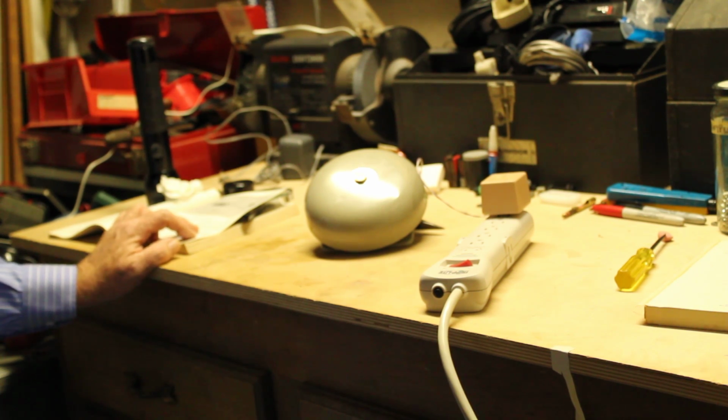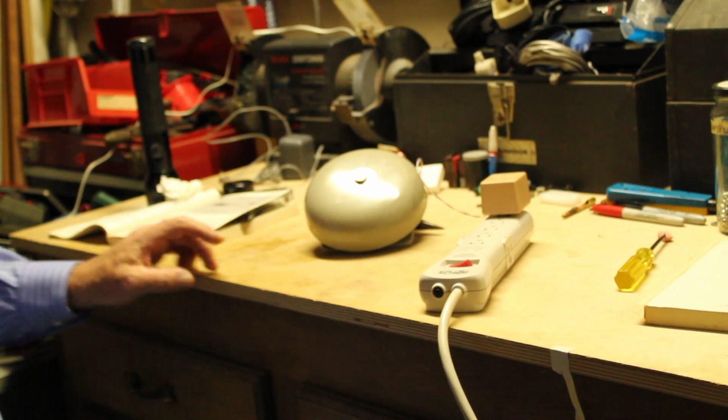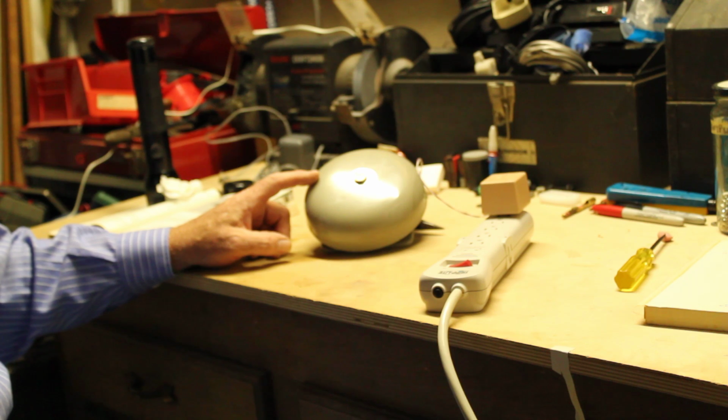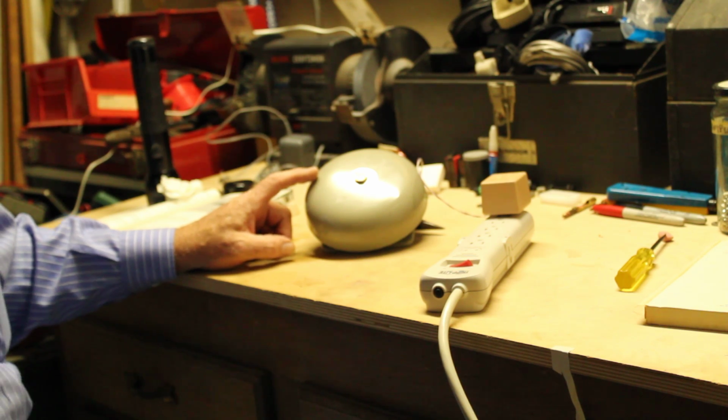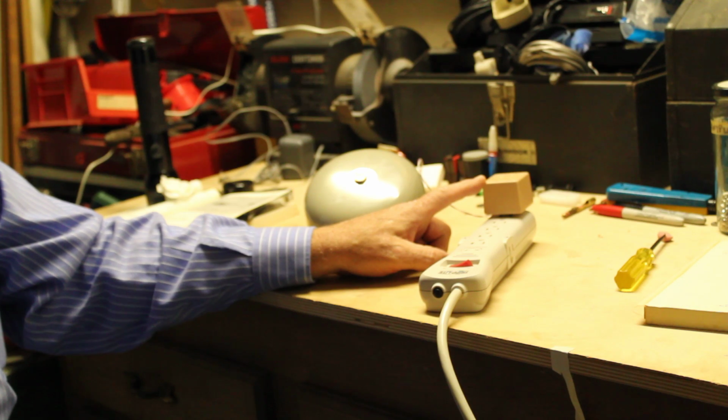Bell System had a couple of different other ringing devices and signaling devices that input different voltages. Typically, ringing of a phone is 90 volts AC, 20 to 30 hertz. Therefore, if you were to wire this bell up directly to your phone line, thinking that, oh, it'll work off your phone, it will not. You must have a proper transformer in line to power the bell.